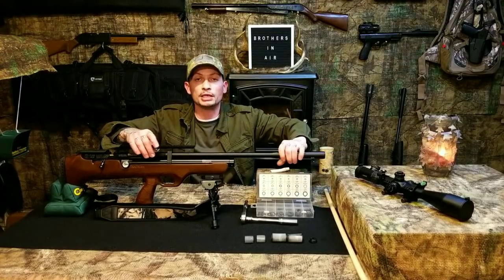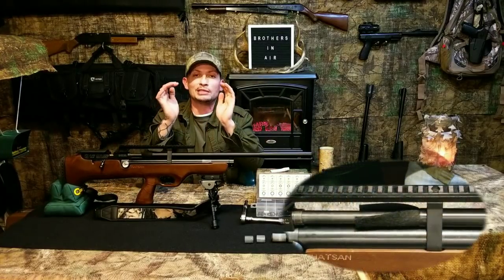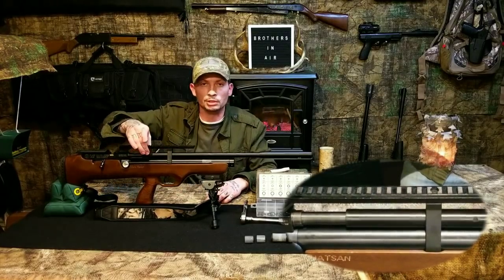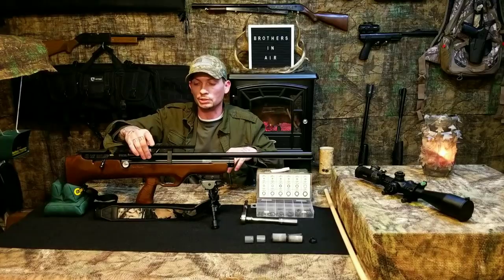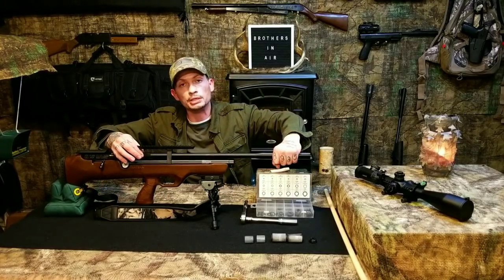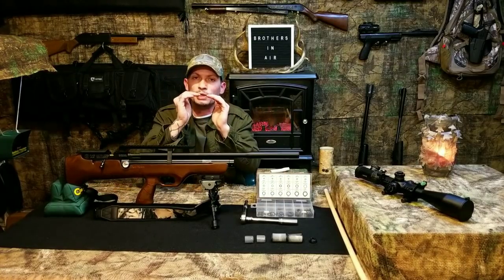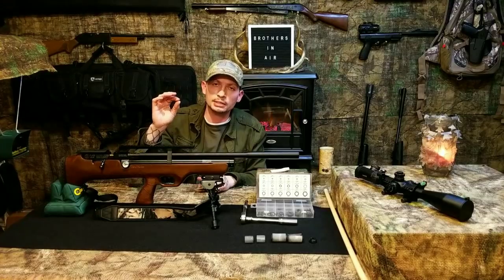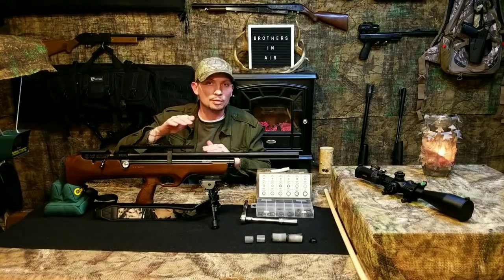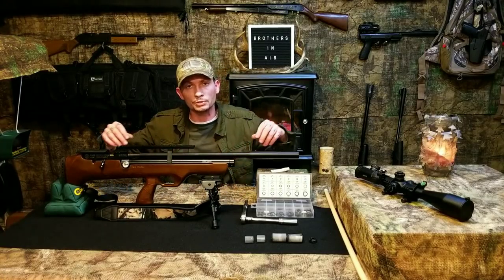You don't have to pull up and try to get the felt seam together with your fingers — rocking the shroud back into place as you're feeding it will just bring that seam up real nice. If you're using high-density two-millimeter thickness felt, it's an excellent compressed fit in the shroud — not too tight, not too loose. It fits wonderfully in this system.